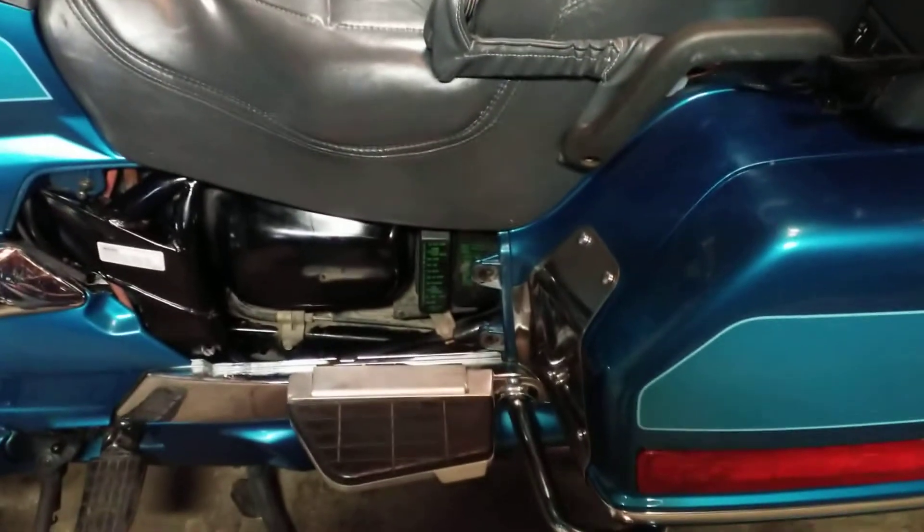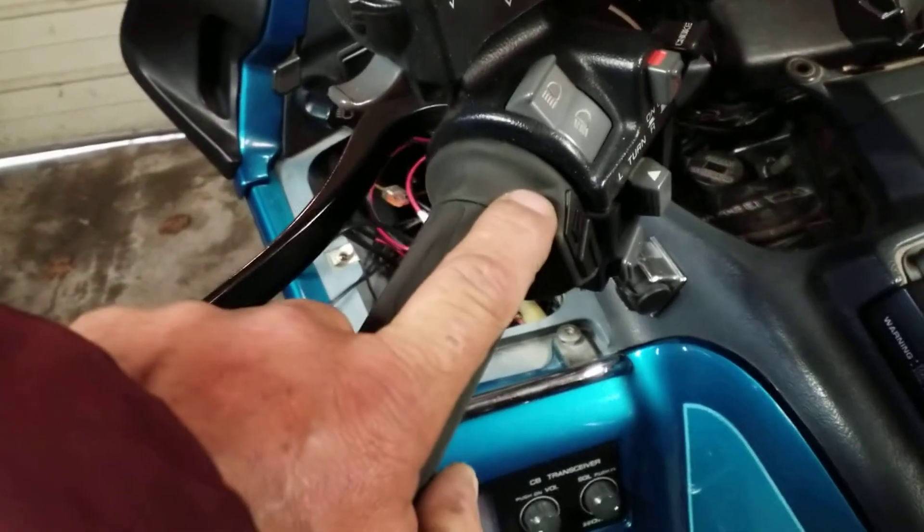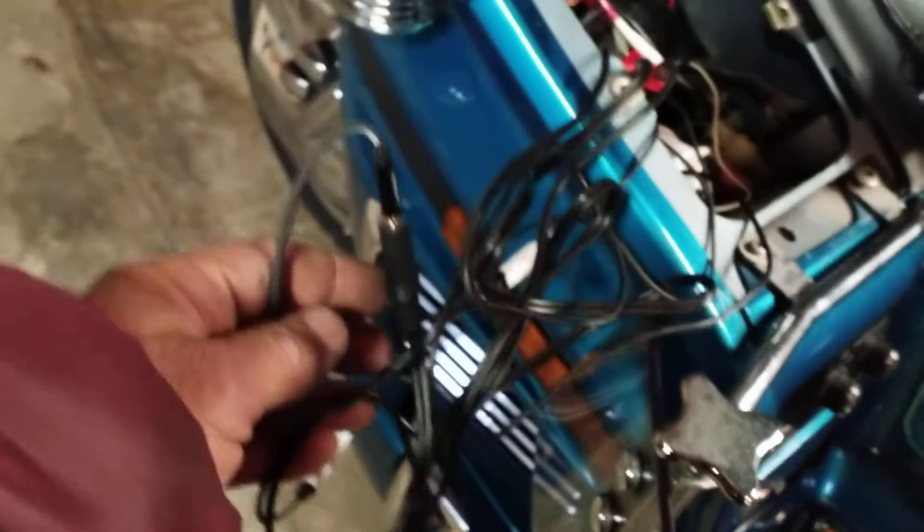I brought six circuits, and there was actually a seventh in my wire harness. Circuit seven went to the top auxiliary terminals on my OEM fuse box. Circuit number two is up here and is what I'm using for the sound system. It's branched between the grip heaters — which needed 7 amps according to the manufacturer — and this double USB port, which is carrying a little Bluetooth device and an audio wire splitter on a 3.5mm jack.